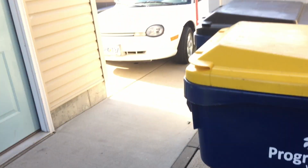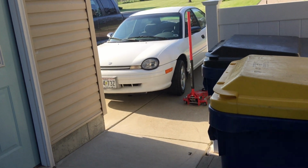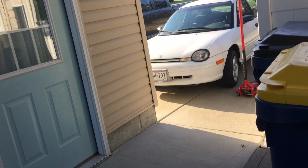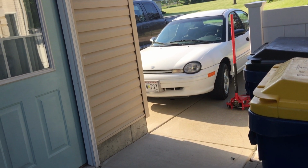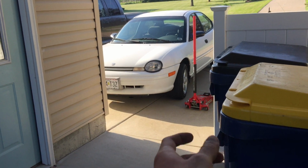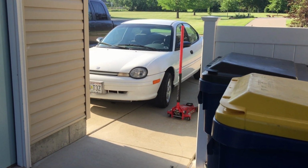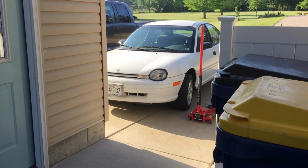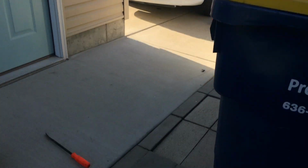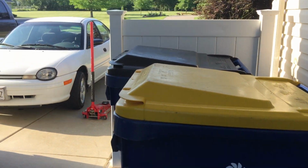The entire underside's bent. I took it into auto body collision, asking the teacher if we could do an alignment on it. And as soon as we put it up in the air, he's like, no, dude, this thing is done. I mean, the K-frame is bent, and then the whole body is curled in. So yeah, I have some adjustable shocks on it and got them as close as I could get them, but you can still feel the steering fight itself when you drive. Anyway, it's got a good powertrain in it.